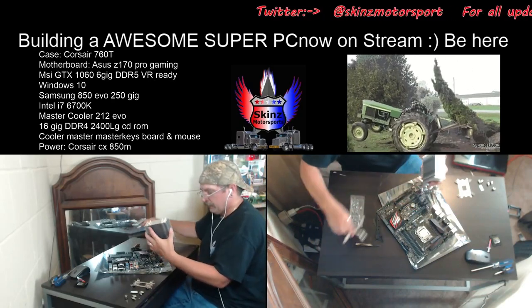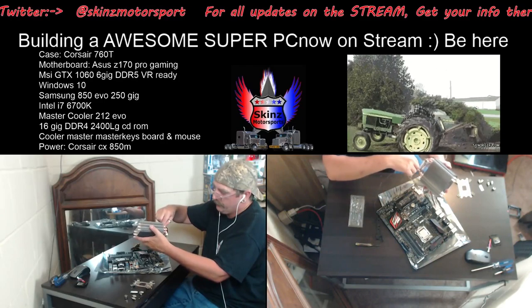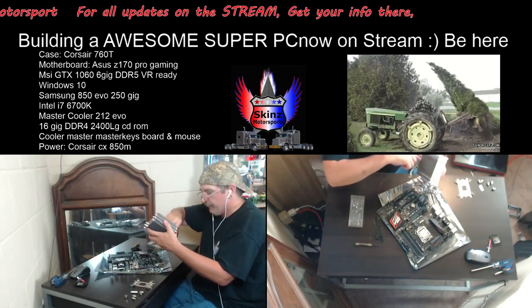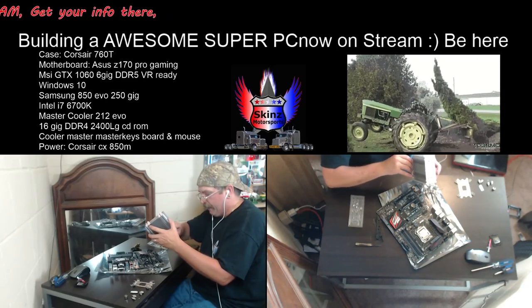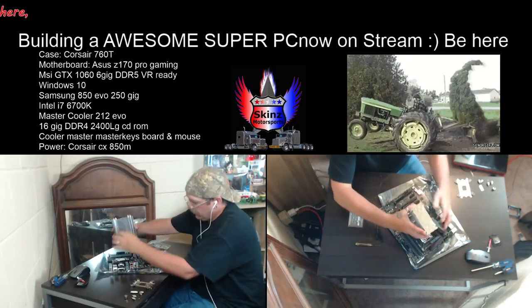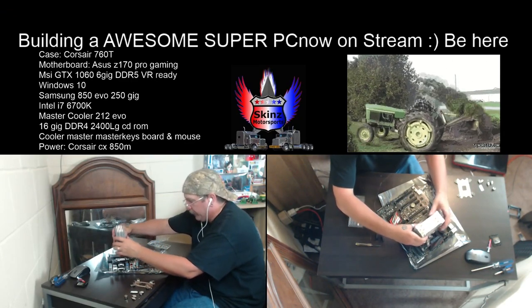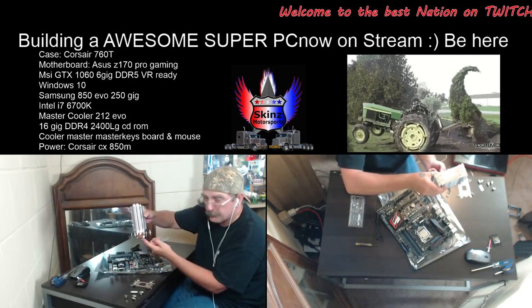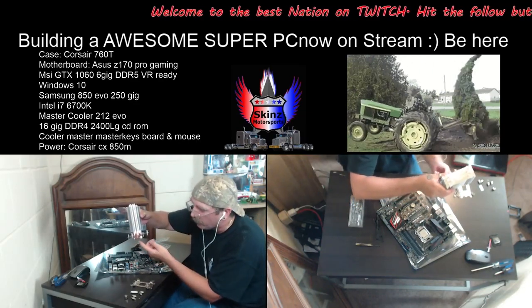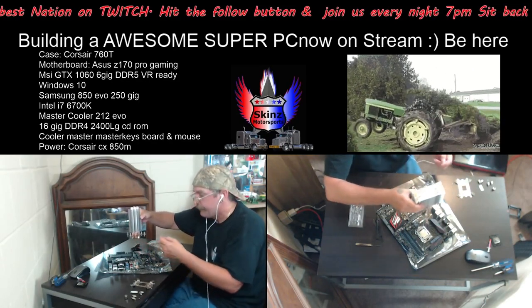Okay. Testing our master cooler. We want to put the mount through the master cooler. Open it back up, and we're going to set it on here very gently. And there's a plastic on there. Don't remove this yet. Do not get your finger oil in between your processor and the cooler.